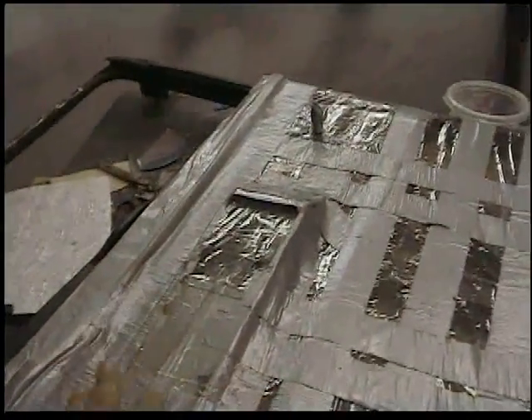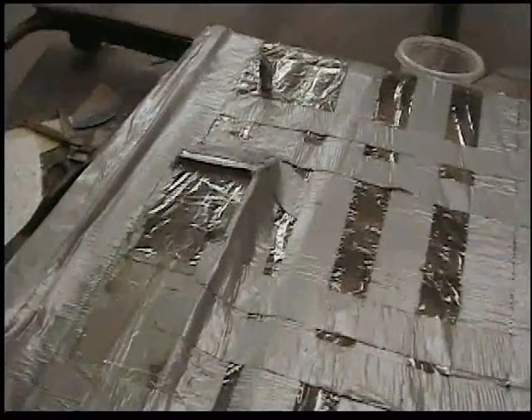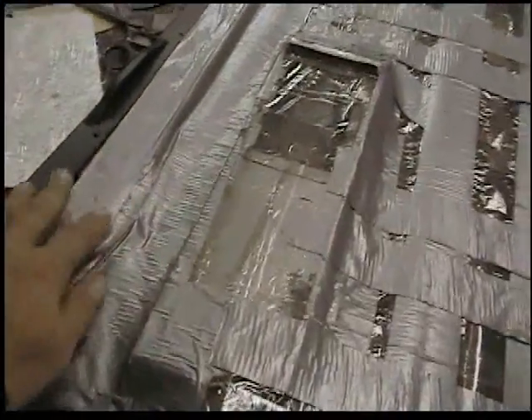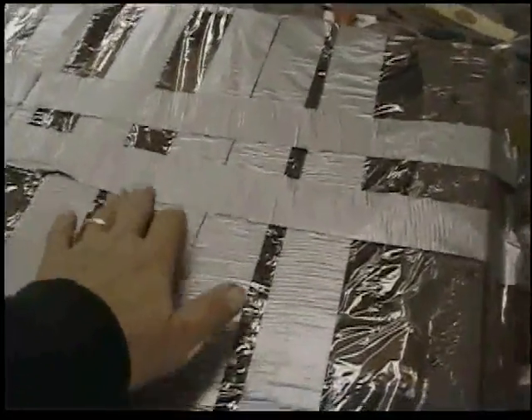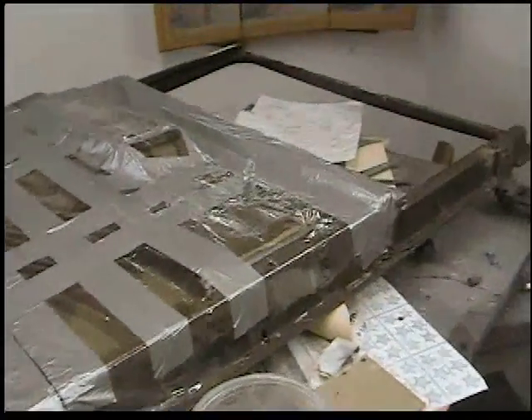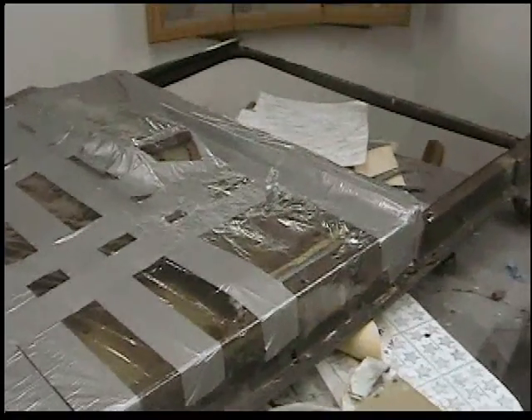This is the driver's side door and I covered the whole inside of it with two-inch wide cellophane tape — the kind you use when taping boxes for shipping. Then I put some duct tape here and there because I thought the cellophane would sag a little bit, so I ran some duct tape just for strength. But it doesn't matter because the fiberglass resin won't stick to duct tape or to the cellophane tape.